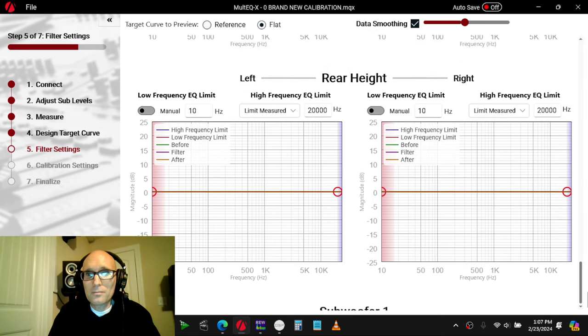Plus, after you finish calibrating and you are on 250 hertz, you put the 120 hertz filter back in, it rolls off absolutely perfect. You don't have to use any complicated math or get into the EQ section and start designing room curves or anything like that. You don't have to do any of that. So that's why I will do EQ to flat, like I'll show you here.